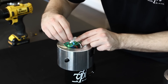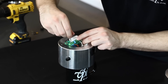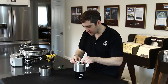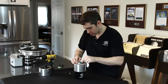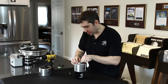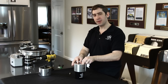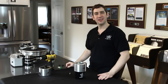Don't get frustrated if they get a little fussy — all works out in the end. I'm going to start by first putting all the wires in for that first set, giving them all a little turn to tighten it up. Then putting in the next set of wires, matching up the black label with the black wire, white label with the white wire. And we're done. Then we put it right back into our motor pod, grab the bottom plate, put it on top of the motor, and screw your original feet back on.